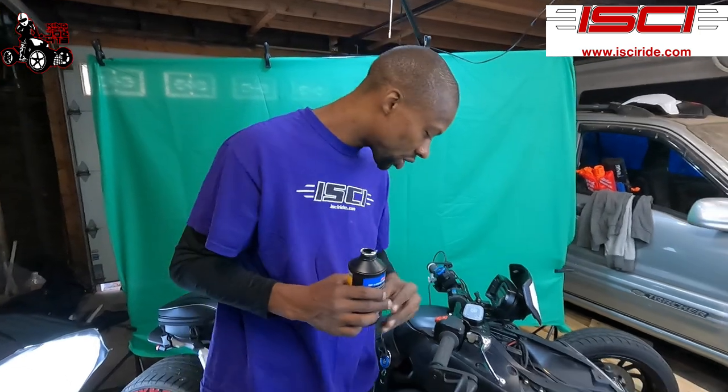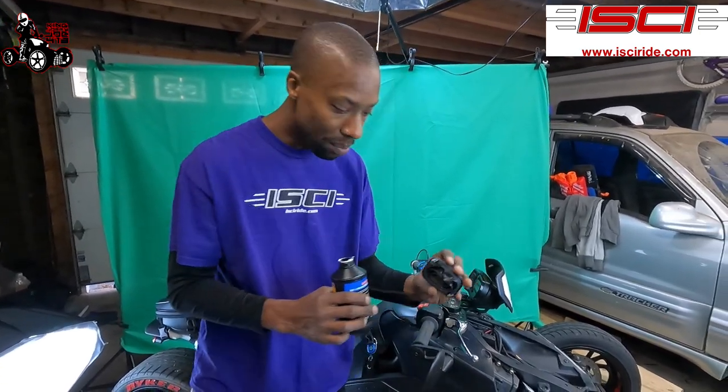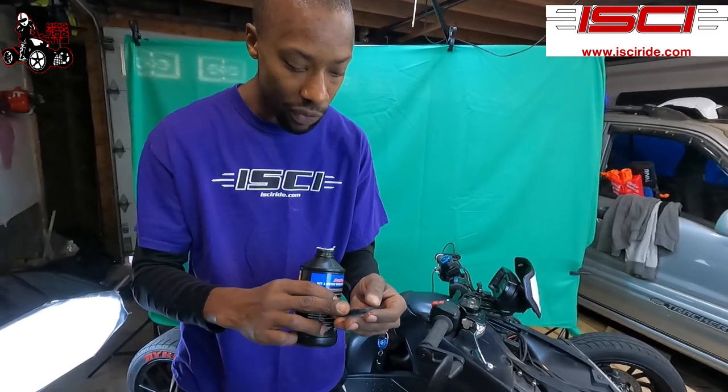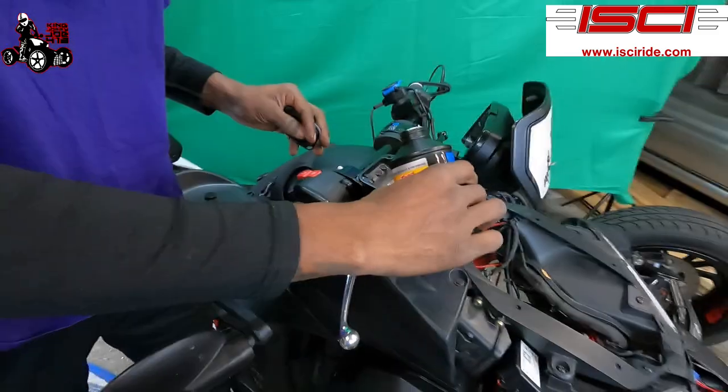All right guys, so had a little pause real quick because I checked my stash. We didn't have no DOT-4. So you wanna make sure you get DOT-4. I had DOT-3, but we didn't have no DOT-4, so we wanna do this right. So we had to run to the store, grab some DOT-4, pull off the little plastic thing, a little bladder's gonna come off with it here. You see? And we're just gonna fill her up. We're gonna fill up our little reservoir.